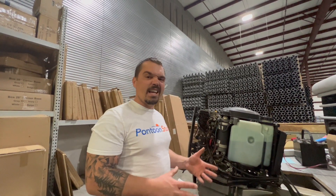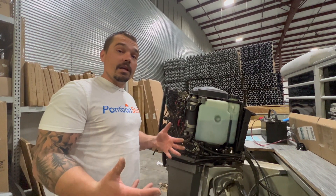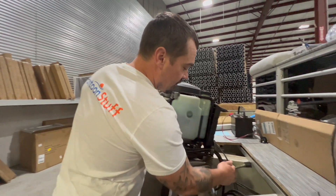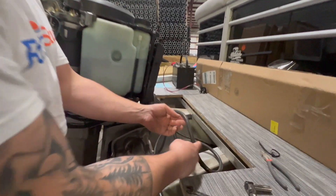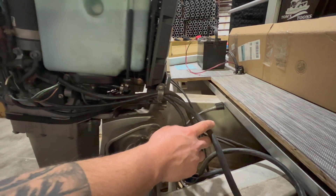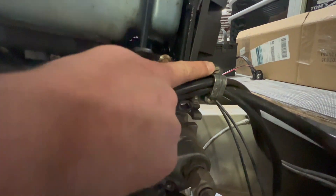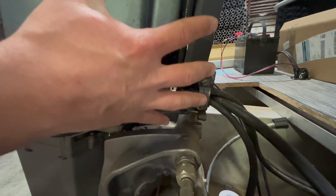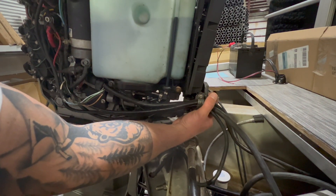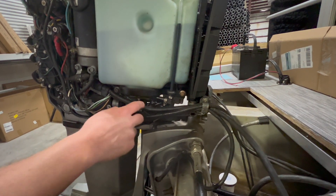This is a late 80s, early 90s — I don't know the exact year. It's a Mariner, but it was made by Mercury in that era, so this is going to look identical to a lot of Mercurys. What you typically have is that same main wire harness that runs back from the dash or from your shift throttle box and ignition switch. You're typically going to have something that holds that in place — in this case, it's a little U-bracket. In newer ones, it's going to rest in the hood with a little cup and a rubber grommet. You're going to remove that, so this will be our first step: getting our electrical harness undone.